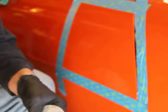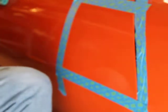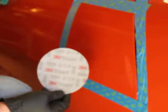So these are the products that I'm using now. This would be the 3M Trizact clear coat. Now the Trizact is for wet sanding, actually spritz water sanding is what I call it, and works really well. I did use the dry 1500 on some of the car, and I do like that also. It's really easy to see where you've flattened out the orange peel, but you go through a lot of paper. So I went with the 1500 Trizact, and I do a lot of wiping to make sure I'm not going too deep, and it works really well. Then I follow it up with the Trizact 3000.